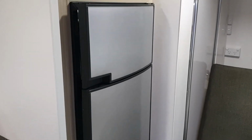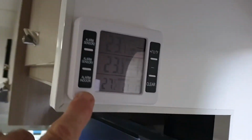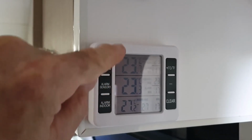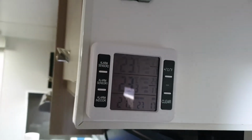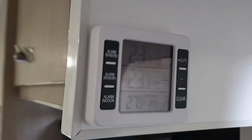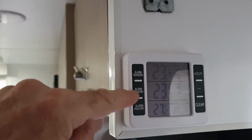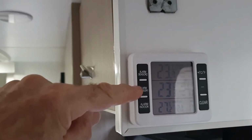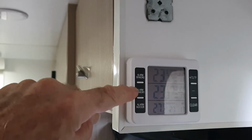Really good. So the freezer, I see within, I've got temperature loggers in here, little temperature sensors, one on the fridge, one on the freezer. And they come up on this display here, which is difficult to see, but so freezer and fridge. I see this, this is down from 30 degrees, it was down to 10 degrees within 15 minutes. And within, so the freezer comes down quickly first. You'll always see your freezer come down quickly, and then the fridge trails behind it. Once this gets down to around about the zeros, then the fridge starts cooling down. Much bigger area to cool, of course, so your freezer's much more responsive.